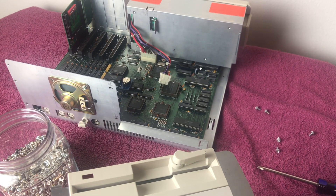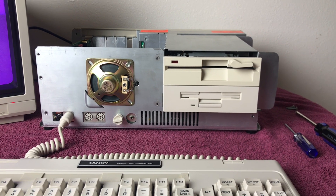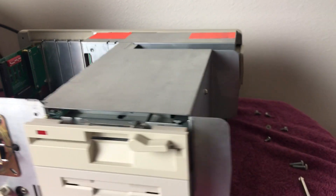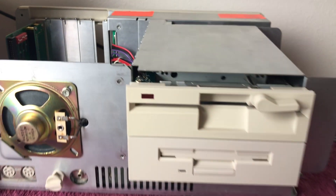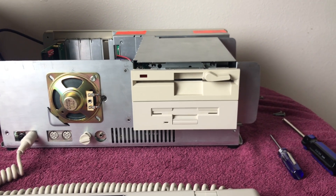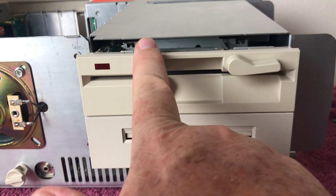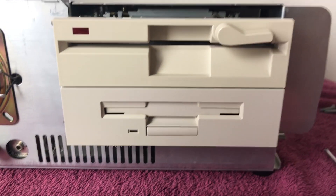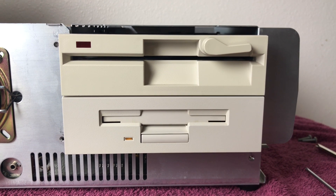When the weather gets better I'll probably Retrobrite it to get it a bit lighter. Let's rough fit it in here, hook everything up, and make sure it works before we button up the whole machine. We are now in sit-down mode. The five-and-a-quarter drive is installed, the drive bay enclosure is rough fitted — no screws yet in case things don't work. Let's turn on the machine and look for the seek light on the A drive and the seek light on the B drive. There's A, there's B — machine is booting. We are at the C prompt.